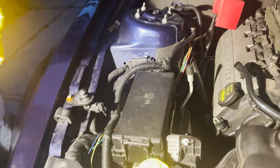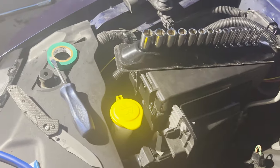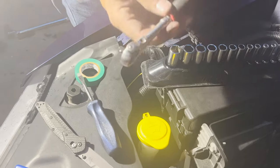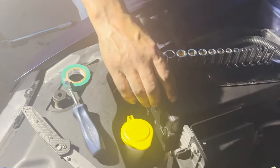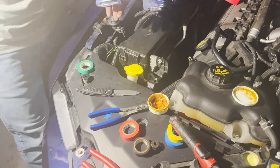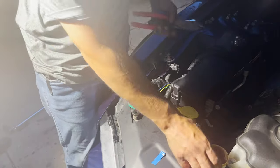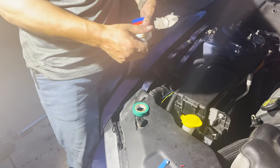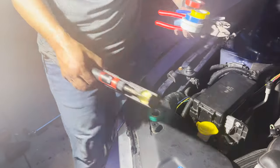And then you can just kind of pick up some tools here. We'll talk about the tools a little bit. I'm using a metric socket set, this one that I have. I used one extension, it's about a 4-inch, 1/4-inch ratchet. I like the swivel head style. It worked like a screwdriver, gets things done a little bit quicker. Talked about the soldering iron. I got a flat blade screwdriver that's helping me with tabs and whatnot. Pocket knife, you can use a razor blade. Wire strippers, some pair of cutters. You got your water soluble flux and your solder. Electrical tape. And we'll go over that a little more in depth too in another portion of the video.